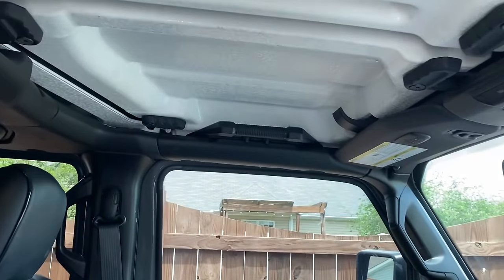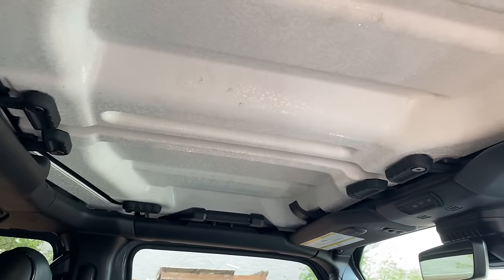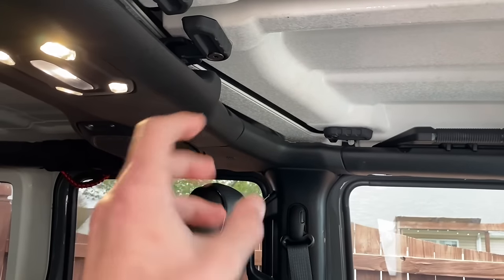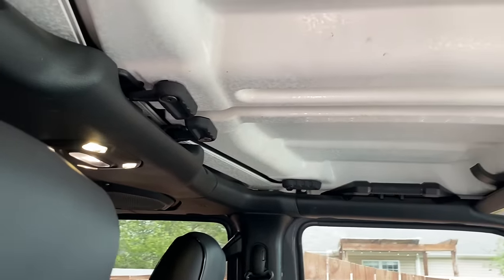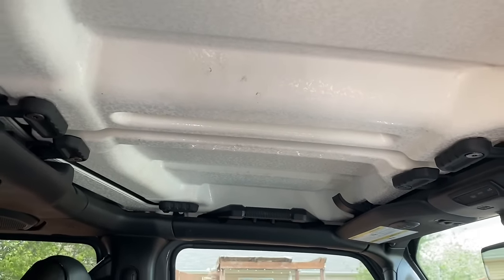Now before we even get started, if any of you guys have owned a Jeep Wrangler and you've never taken the doors off or the top off, go ahead and hit that subscribe button. So on any of the JLs or even the JKs, no matter if you have a two-door or four-door, the first step is going to be removing your actual freedom panels. You've just got some levers and that's pretty much it for a JK. You will have a little turn knob right there, basically into the sound bar, that you'll need to screw out. For the JLs they did do away with it, but you simply turn all those knobs and you'll be able to lift these off. You lift the driver side off first, then you can take off the passenger.